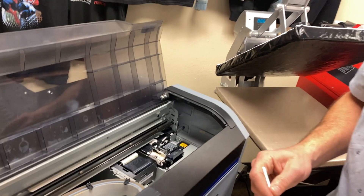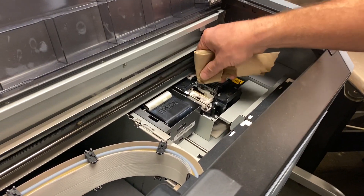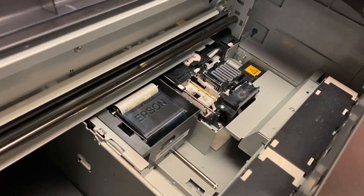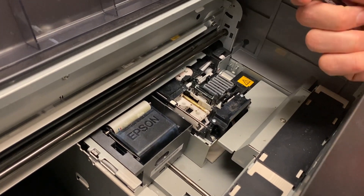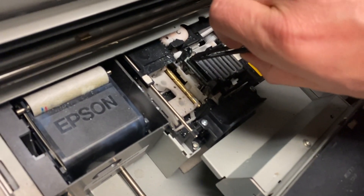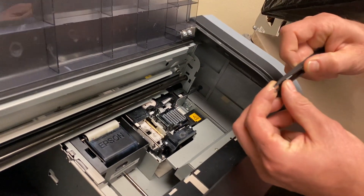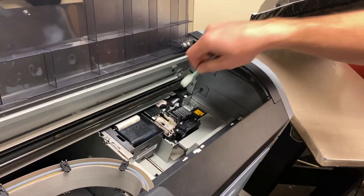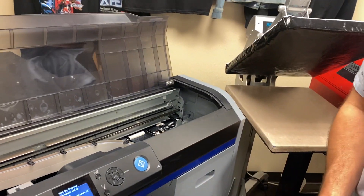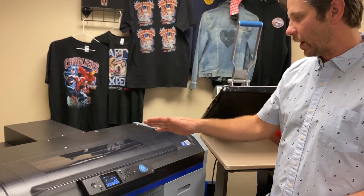I like people to do this about every week or so, or as needed — and I'll show you what the indicator of as-needed looks like. I've got it pretty clean now. I just need to make sure the sides are clean, the rubber has good contact, and there's no ink built up in there. Your tweezers are in your ink bay. There's some ink buildup on the side here, so I want to try to get in there and break up that buildup. I should be able to just pinch it and pull it away. That ink that was built up there is gone now, giving me peace of mind in knowing I have a good connection between the printhead and the capping station. Once you're comfortable with it being clean, you can shut this and hit the OK button, and it'll bring it back over.